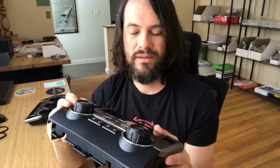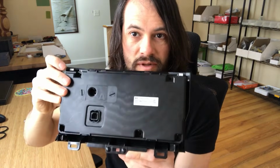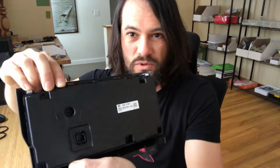The installation is very similar between the two, but I'll try to use this video to cover both. So you'll remove this part from the truck, again, separate video on how to get this out. On the back, you will see we've got 1, 2, 3, 4, 5, 6 small Phillips screws that you'll need to remove with a Phillips screwdriver. This has been pre-removed just to make this video go a little bit faster. With those removed, you just pull on these clips and this back part will come out.